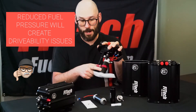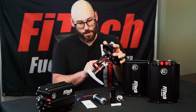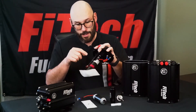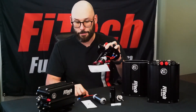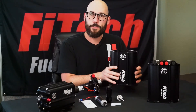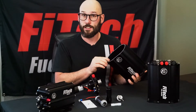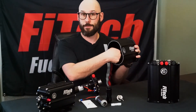If you need to replace the fuel pump, all you've got to do is loosen this clamp, take off your fuel outlet hose clamps, and disconnect your connector. From there, the fuel pump will slide out of the bottom and you can slide in your replacement. When you remove the top of the force fuel system, it's always a good idea to flush out the inside, as small debris can get in over time and there could be sediment down in the bottom.